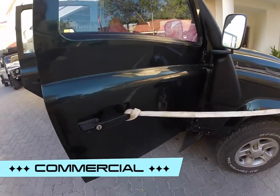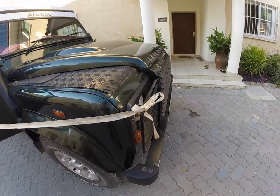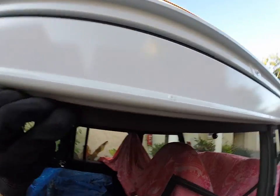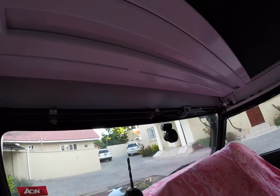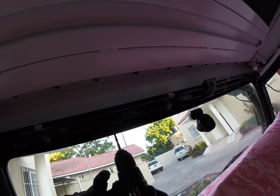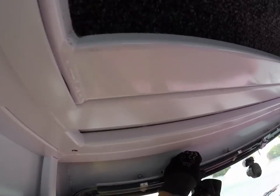To keep the doors open, get one of these Frontrunner door-open straps — they're quite amazing, come in exactly the right length, and help keep your Land Rover door open. We're now riveting on the L-profiles that Alokab provided for the gaskets that go over the door and seal the door against the roof. Alokab thinks four or six screws and the main window are enough, but since Land Rover originally used eight screws including these ones, I'm drilling two more and using lock nuts in case corrugated road rattles off the windshield.